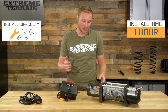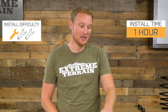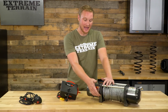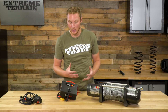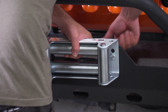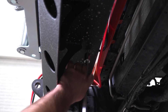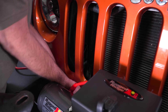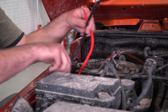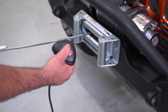As for the installation, you are going to need a winch-ready bumper or a winch plate on your bumper. But if you have that, this is a one-out-of-three-wrench, one-hour installation. These winches, for the most part, have a body that is small enough to fit in or on almost any winch-ready bumper or winch plate, and the bolt pattern for the feet is going to be pretty standard as well. You're going to be able to first mount your fairlead — it's just a little harder to get to the bolts once the winch itself is mounted. So mount your fairlead first, then mount the solenoid box right on top of the winch. You'll have a couple of connections to make between the solenoid box and the winch itself, then get your winch bolted down. Finally, run your two longer cables back to your battery — through the grille, under the grille, along the fender, however you need to get it to the battery to connect to the positive and negative terminals. After that, in order to use the winch, you just plug your remote into the solenoid box. You're going to have two buttons on top — one for in, one for out — and you're ready to winch.